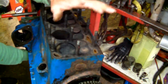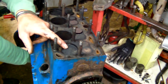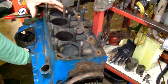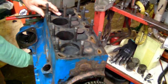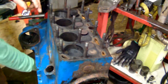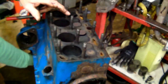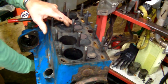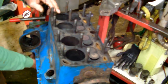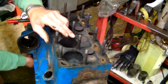That's number one firing — assuming you've got a head on here, it would have fired now, so compression is now driving the piston down. Once that's starting to drive down, this one is now taking in fuel. It's firing order one-three, so number three's ready for it — it's coming up. So: fired on one, fired on three, and now this is exhausting. We've had one fired, three fired, four is compressing and fired, number two is getting ready — it's filled up.